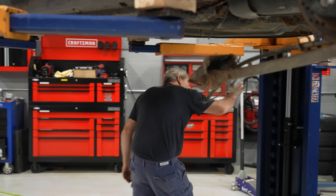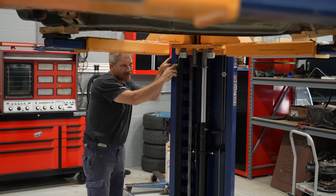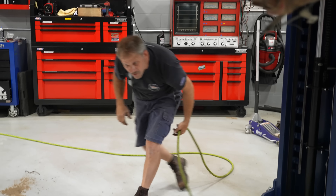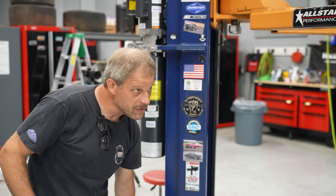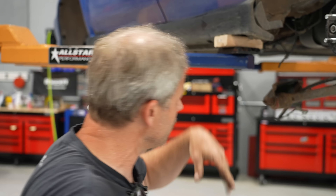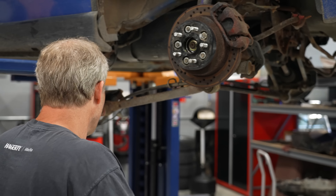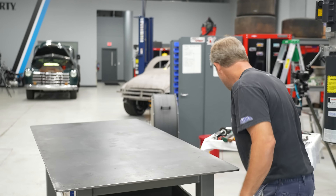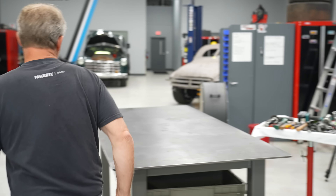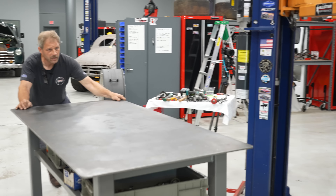You ever get a feeling it's getting worse? Give me just a little bump. All right, so at this point I have everything I'm comfortable with without this falling out. Struts are off, the lower control arms are unhooked from the body, sway bar is out. I think all I have is six bolts here left for the cradle, and then that whole thing should drop down onto our cart — just like we did the motor.